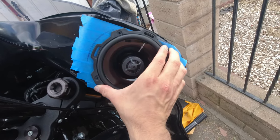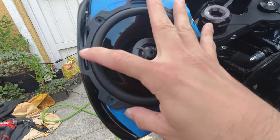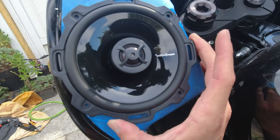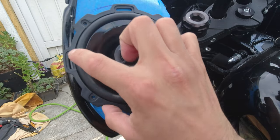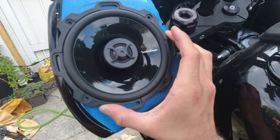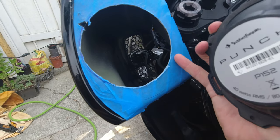You can see all the dust going up — a lot of fiberglass. This stuff you do not want to breathe in. Make sure you wear a respirator or mask to filter out all those micro fiberglass shavings. I also scratched my paint because I wasn't expecting the blade to kick up like it did — you can see the white scratch from the air saw. If you want to completely protect your fairing, cover it fully with blue tape, because masking tape protected most of the scratches.